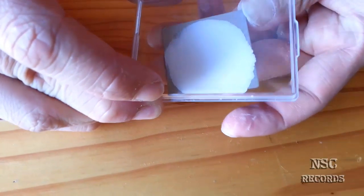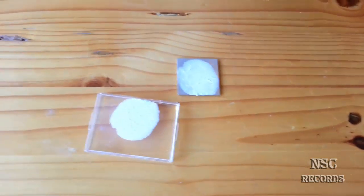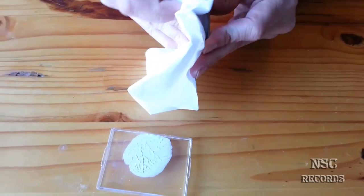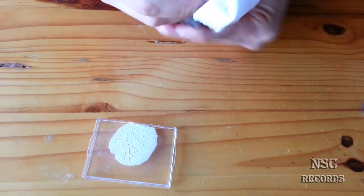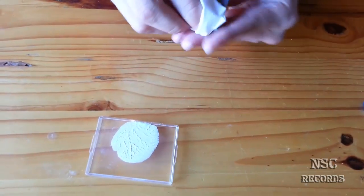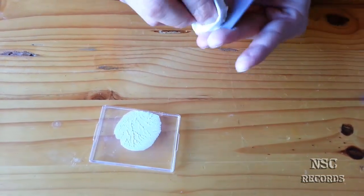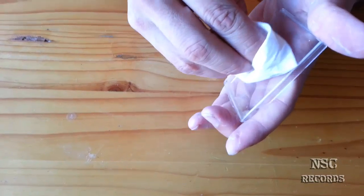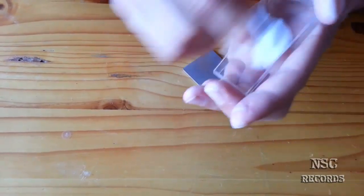Okay, guys. That's why I just wanted to make this video to prove to the guys out there that these air bubbles just come when you take off your chip again. The most important thing is that you really need to take, not that much thermal compound, but it should be a bit. And when you just do a little bit of thermal paste, then you can also have bad cooling. But the most important is that it's not too much, and not, we can say, too little. I hope you can understand my English. Sorry again for my English.